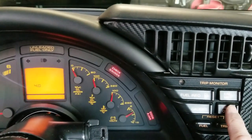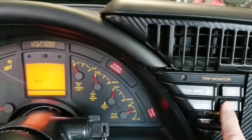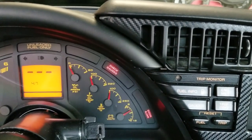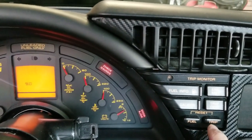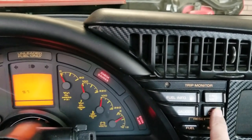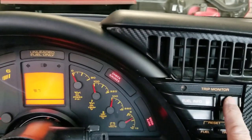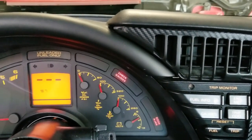We're going to hit the trip odometer button and it's going to cycle through until we get to 4.7. Then we're going to hit the English/metric button until we get the three lines. Now we're going to hit the trip button again and that's going to put us into the 9 computer. We're going to hit the trip odometer and we've got to 9.7, and now we're going to hit the English/metric button again — that's clearing everything in the computer until it's all cleaned out.